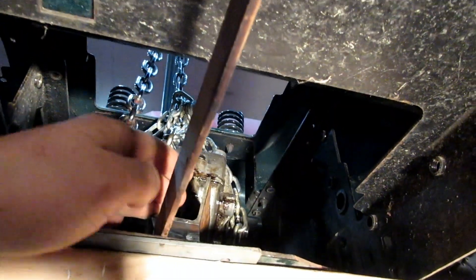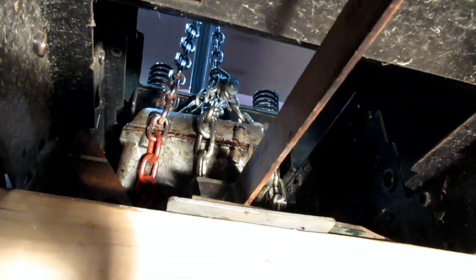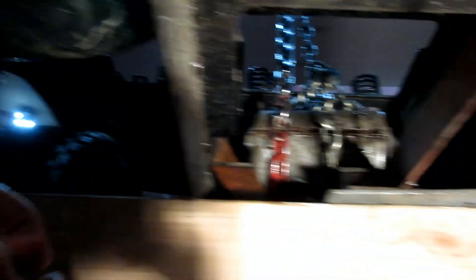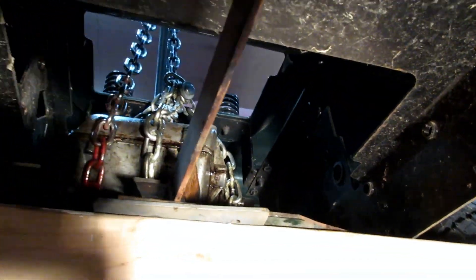All I have to do is take a flat piece of inch and a half flat iron or square tube to go from here to here to then weld the front part of the transmission mount in place. That will get it in the right spot lined up the right way. What that does mean, however, is that if I want to remove the transmission I have to go up top, which means removing the fenders and the seat mount — but that is actually easy because it is only 4 bolts.